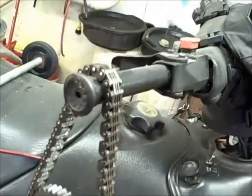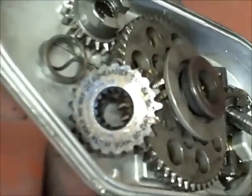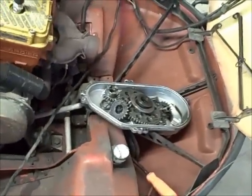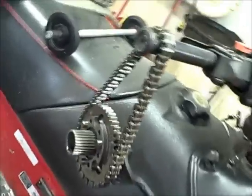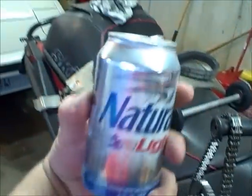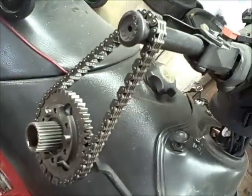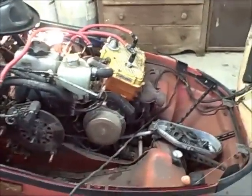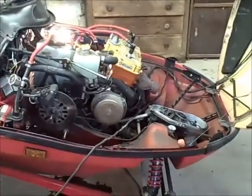That's the stock bottom gear right there and I'm also doing an upgrade on the upper sprocket. The stock one is a 23 tooth and the one I'm using is a 21 tooth - from a 380 Ski-Doo which has a stock 21 tooth upper gear. That upper gear drives the lower gear, and by making it a little bit smaller it makes less load for the engine and it's able to take off faster. I'll lose a little bit of top-end mph but I'll gain a lot of speed out of the hole.